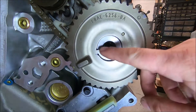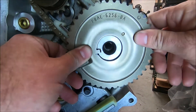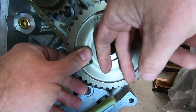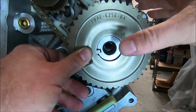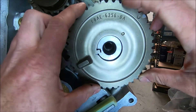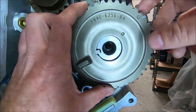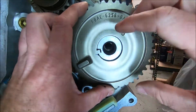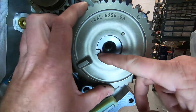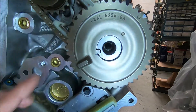The other thing to keep in mind is that if you grind on this keyway and you don't make sure that the sprocket stays up against the side of it, you're not going to see any difference when you check your degree. So you need to apply pressure — that can be by hand, or you can have somebody hold the camshaft — just to make sure the sprocket stays up against the side that you grind it on. I'm going to go ahead and grind on this thing and see if we can get a couple degrees out of it.